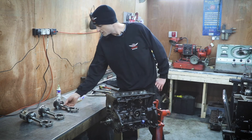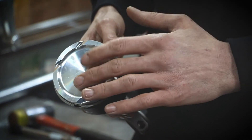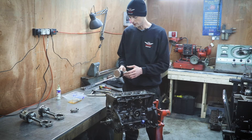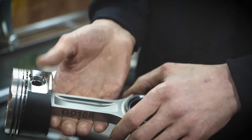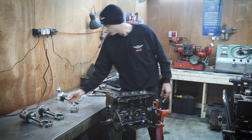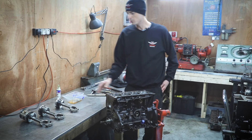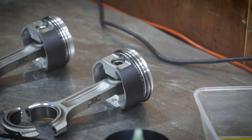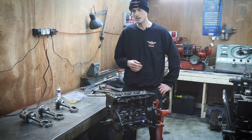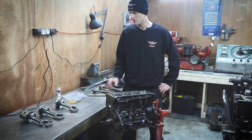As part of the upgrades, all of these components are new. We've got new pistons for a lower compression ratio — obviously we need a much lower compression ratio to effectively double the horsepower. These come with new rings, gudgeon pins, and these lovely forged rods. They came quite nicely balanced — the rods were all within 0.1 of a gram of each other at 600 grams. The pistons were very close; three were within about 0.2 or 0.3 grams of each other, but the last was a whole gram lighter, so we've done a bit of work to balance that. All of those are now within 0.1 of a gram as an assembly.